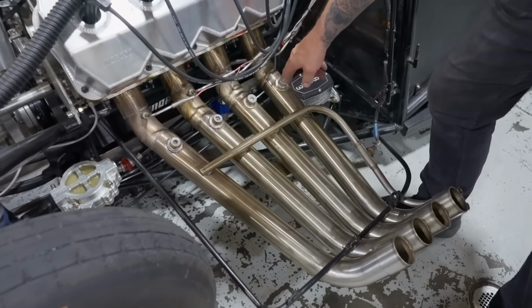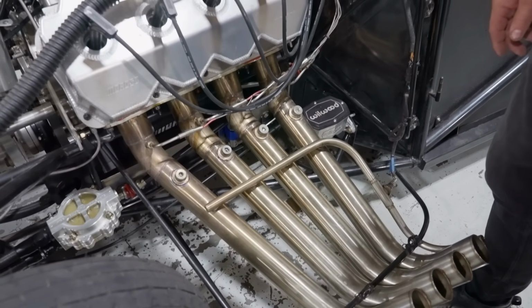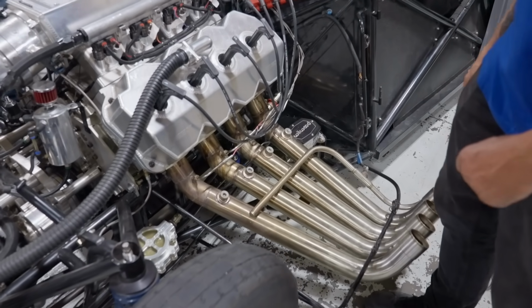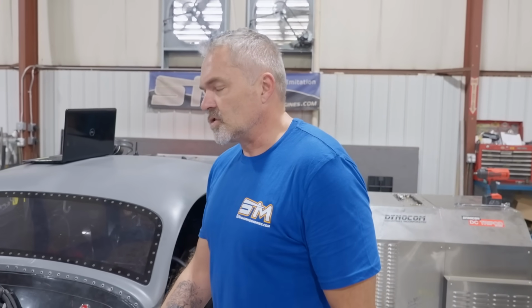This has 8 O2 sensors, but in my personal experience, that is far too much information and far too hard to tune. There's too much going on there. EGTs, awesome. 8 individual EGTs, average the O2 here. It does everything you need to do right there without giving you so much fine detailed information that you get lost in the woods because of all the trees. It is really hard. So anyways, we'll change this over.